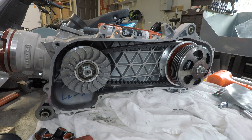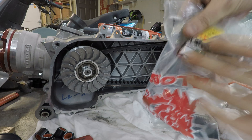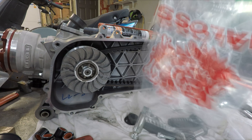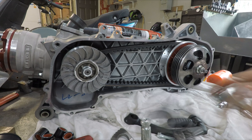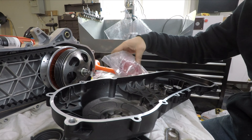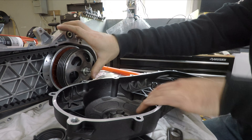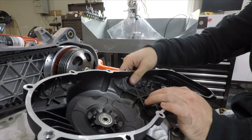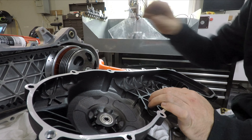This is the kicker bag. Inside is all this stuff along with the kicker spring and this is the kicker cover - it is integral to the assembly. It actually has the bearing here. You cannot run these motors without the kicker cover on - you will wreck everything. This is the selector gear for the kicker, it goes in here like so.